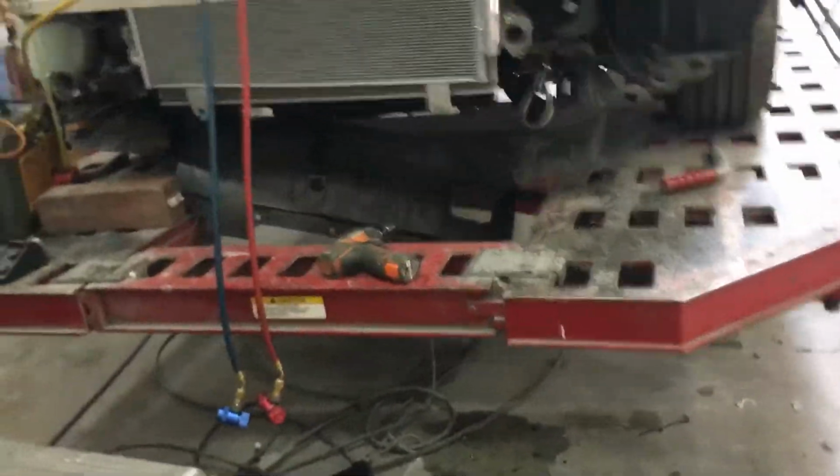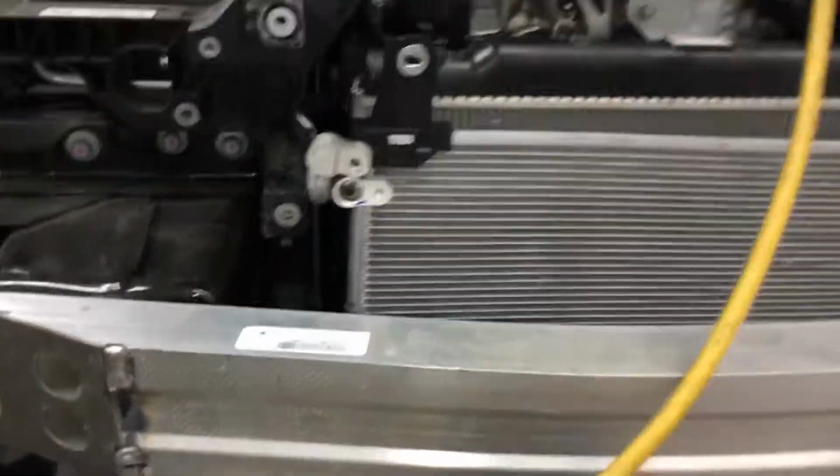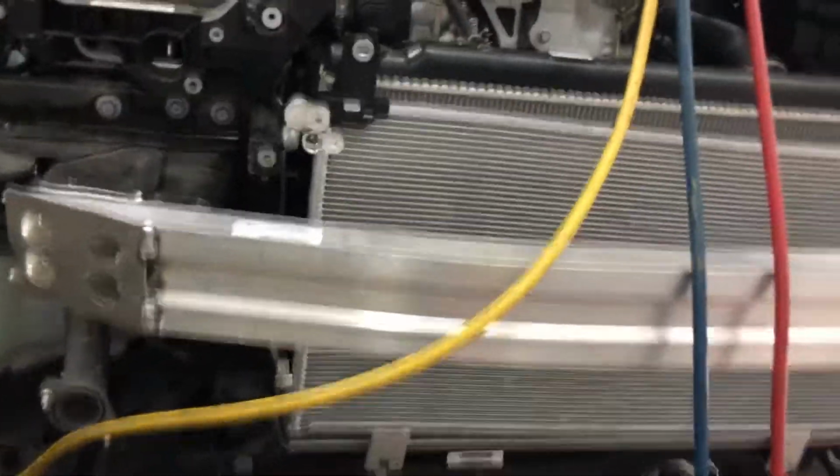Imagine if you let this job go and 5,000 miles later the radiator core starts leaking at the areas down in the corners where it was tweaked over, bent over once and then bent back over. Yes, you saved money, you might have saved time and a few phone calls, but you can roast an engine because you get a radiator failure 5,000 miles later. I've seen this happen more than once.